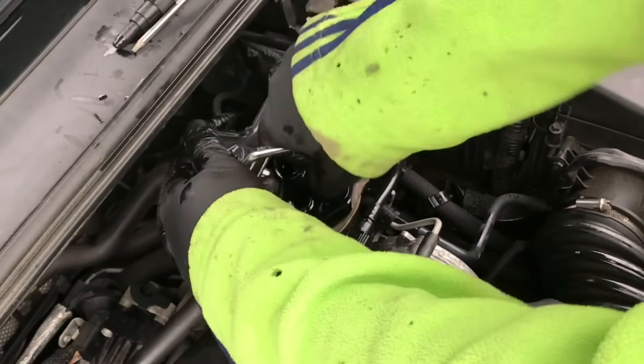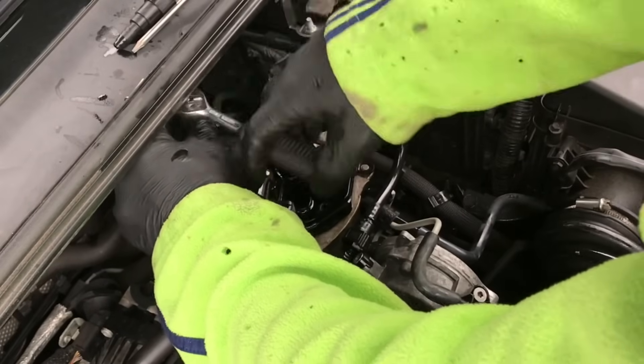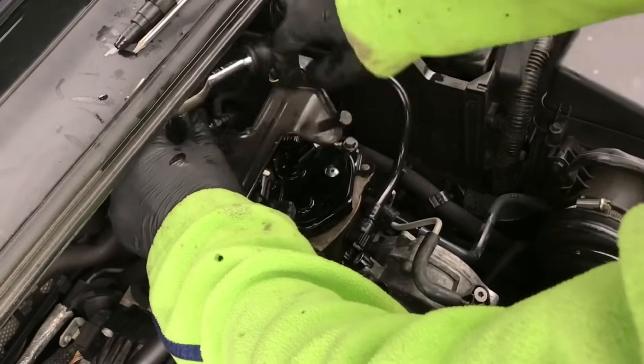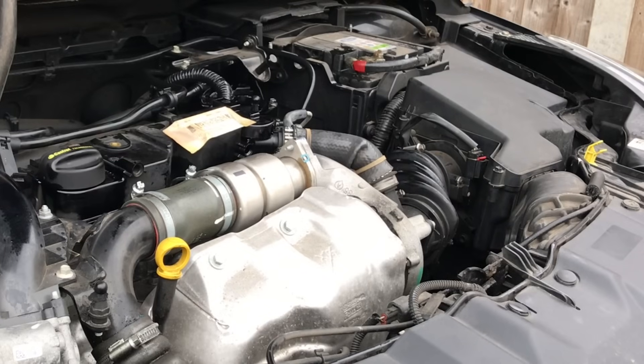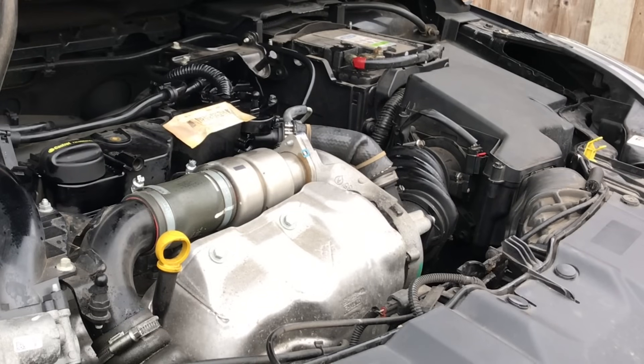We're nearly there. Once these bolts are down we can have one last wipe round and with a bit of luck the thing will start straight up — though these can be a nightmare if you have air in the system. Hallelujah — fired straight up! The key now is to lift the revs and keep it at about 1,500 to 2,000 rpm for a short period. If there's any air in the pump it'll force it through. Don't let it idle straight away or the air can get stuck and you won't get it going again — just keep the revs up and let the diesel circulate.